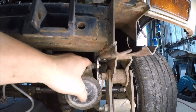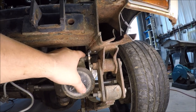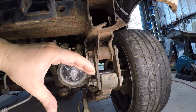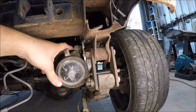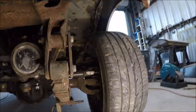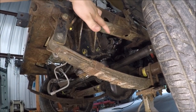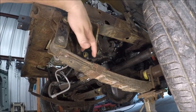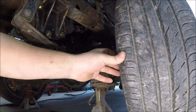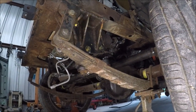You can't just put a flat plate there — you need to take up the space. Because if you just run the bolt and leave it exposed, what's going to happen over time is that this steel is going to start to give and start bending, and it's going to eventually cause these bolts to get loose. I put these gussets on there just to ensure that when this gearbox is under tension — when the steering is under tension and it's turning — the gearbox doesn't want to flex in either direction. This adds strength to that L-bracket.